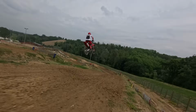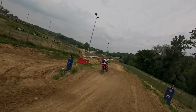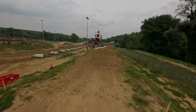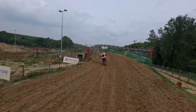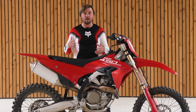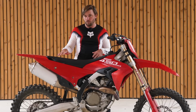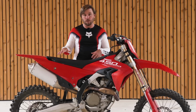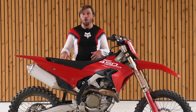Part of that is soft power. Soft power character, in my opinion, always makes a bike feel heavier, and then that extra inertia up top plays a part in that. If I went to a 120 rear tire, I feel like that lean in and stand back up character would be a little bit tougher with the wider tire on it. So I know most guys would probably default to going to a 120. If you do get one of the Ducatis, I would recommend thinking about that before you do it, or even testing a 110 to a 120 back-to-back to really see if that's the direction you want to go.